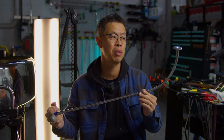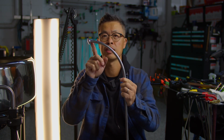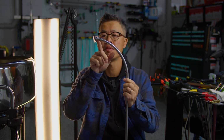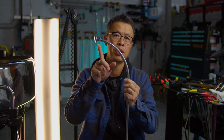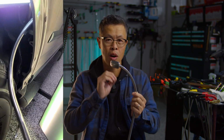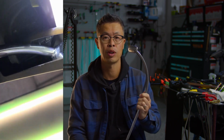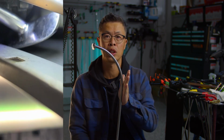Another really big feature about it is that if you take a look here, the weld for the dolly head is at the back of it, at the top of it, and you have sort of a hook-down kind of action here. With it hooked down like that, it actually is really useful for some vehicles to hook down into the bottom lip area. It doesn't get all the way to the bottom on some of them, but it is really useful for getting in there. So you can do the pushing out with the leverage off a tire.